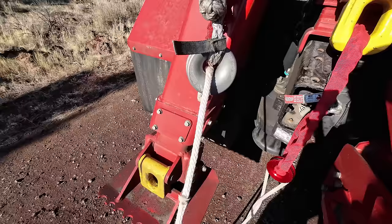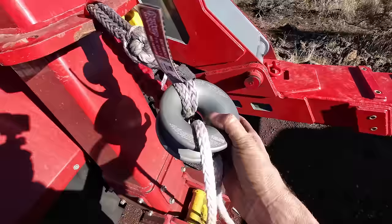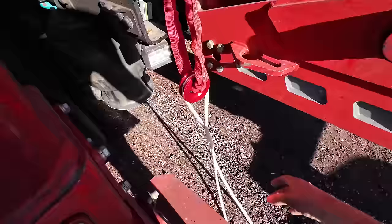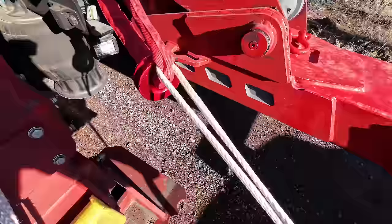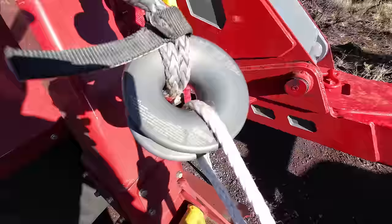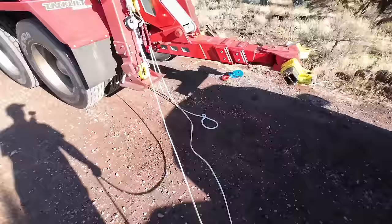Now let's talk about the inner radius of the ring, because that is another hot topic. Anyone who's a five-minute Google expert on synthetic ropes knows that for a transitory loop — where the rope is moving — you need eight times the diameter of the rope. For 7/16-inch rope, the inner radius here is not eight times the rope diameter. Why would Yankum have designed this way if it's made to slide through? Because a ten-minute Google expert knows you need eight times the diameter at peak load. And peak load is around 25,000 pounds — something you're never going to create with a 12,000-pound winch. As peak load comes down, so do the requirements for bend radius. But why not just go around the outside, where it is eight times the diameter? Because if you go slack and pull again, the rope can fall out of the groove — but through the center, it can never fall out because it's in a loop, not a groove.